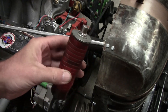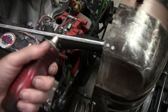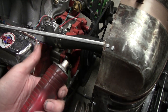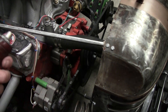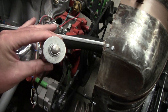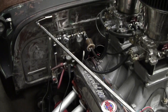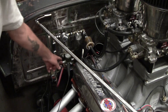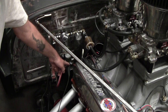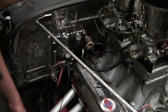The first tool I'm going to use is a bump starter — it helps you roll the engine over, especially with this one running about 11 to 1 compression; trying to turn that crank over is a little tough. Get you one of these, they're super simple and super cheap. They hook up really easy — just go up on the starter. You've got a hot side that goes straight to the battery, and you put this one on the ignition side — the one that goes up to your key — and you hit the button and it bumps it over.